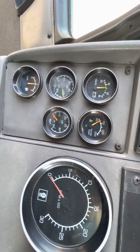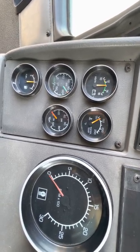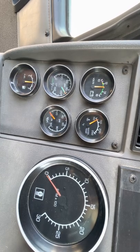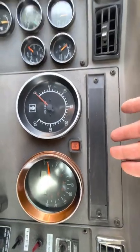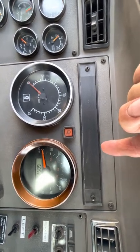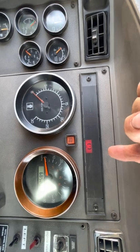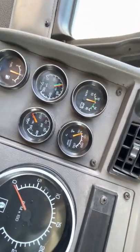Now we're going to pump the brake down until it's between 60 PSI. There should be a warning light or buzzer come on. Our warning light will come on, but the buzzer is already on because of the oil pressure light. There's a red light come on — that tells me that I'm losing air. It came on at 60 PSI. That warning light is telling me to pull over on the edge of the road; the brakes are going to lock up.